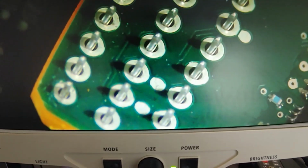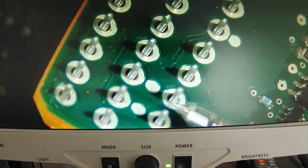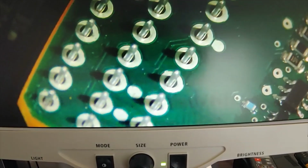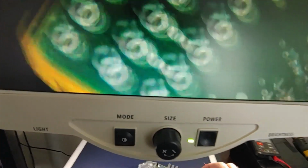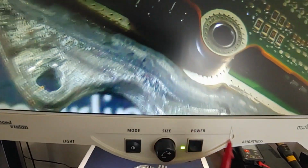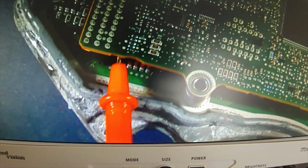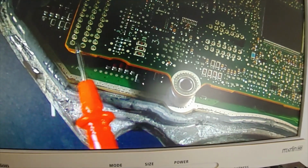One way of doing it would be to compress a pin from both sides and then push it down, and you'd have to do it individually, but it's not possible because there are too many of them, and it's not possible to hold one down while compressing the others. So the other thing people use is some kind of a flat blade, put it over here and wedge this up. They work around the board, and slowly these things come up.